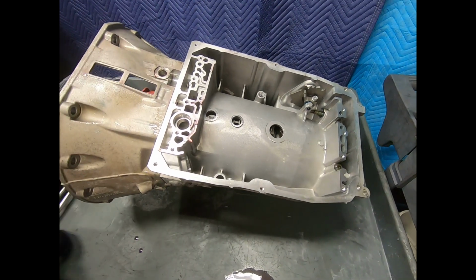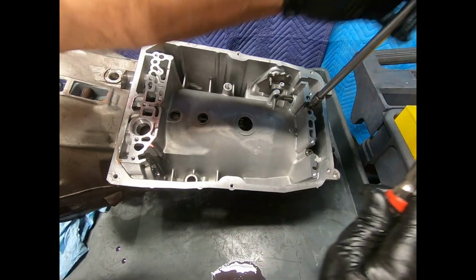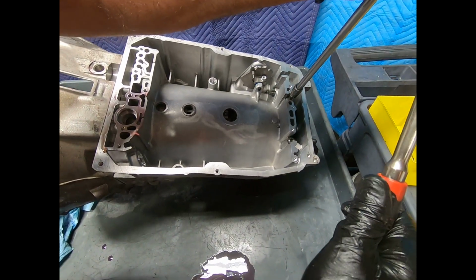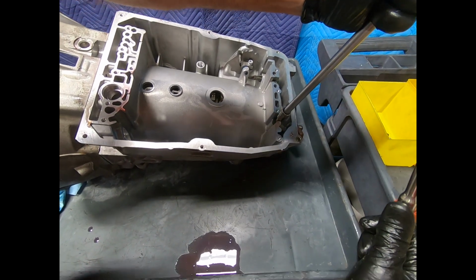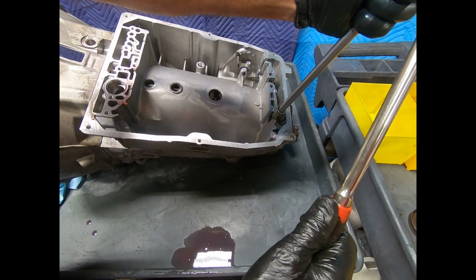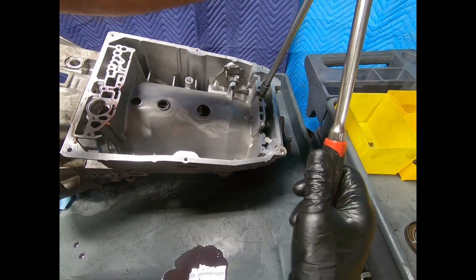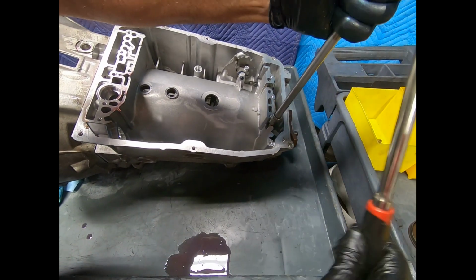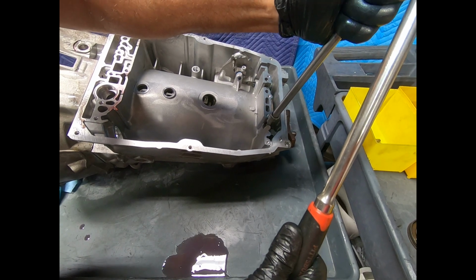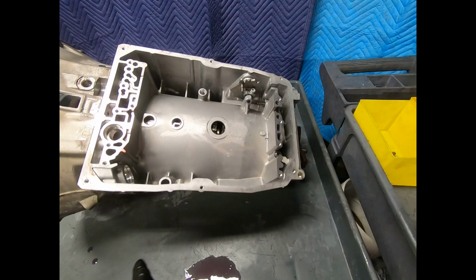And one thing I mustn't forget here, while I'm here, let's go ahead and do it. Careful not to touch the housing right here, but let's go ahead and torque our B2, B3 clutch housing. Remember, we're going into aluminum. This isn't a head bolt, so torque here is measured in oftentimes inch-pounds. All right, that's ready to go.